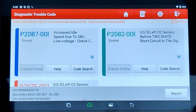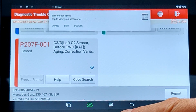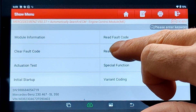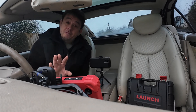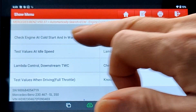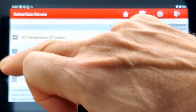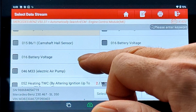I've got all my codes there - my three main codes. That's reading the fault codes. Now before we clear them, let's just have a look at the reading data stream. As the engine's on it might give you a live indication so we can do some tests. I want to do this before I clear the code. You've got test engine idle speed, check engine at cold start and warming up phase. Let's go into the first one - look at all these bi-directional options: intake air temperature sensor, ignition angle, engine speed, temperature of coolant. Let's go into engine speed and idle speed detection there and press OK.